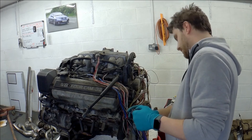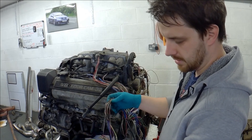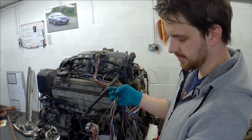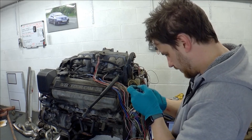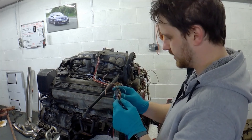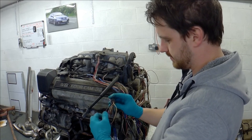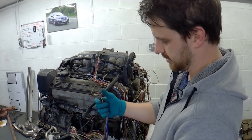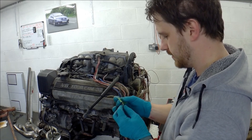TE1 on pin splice to pin 12 on custom plug 1 - that is used, so we need that one. This one goes to what I believe is the dash interface, and that splices into there. Next is pin... you know what, I just made a mistake - that's the check engine light. What a plum! That was the one I was supposed to cut. We can mark this one up as check engine light, because I'm an idiot.